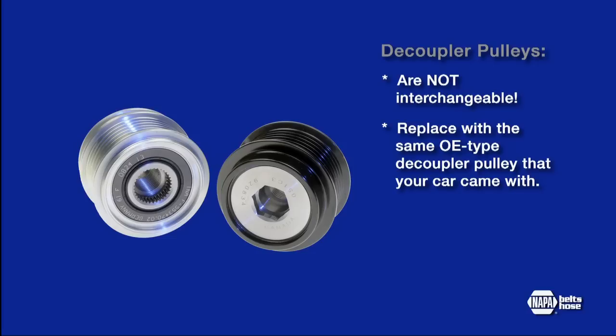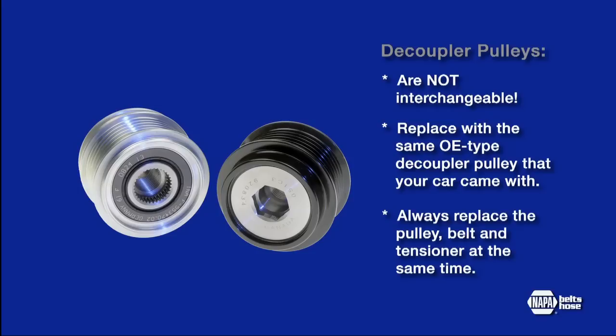The estimated life of a decoupler pulley is about the same as the belt and the tensioner. So always replace the pulley, belt, and tensioner at the same time. You don't want the frustration and unnecessary expense of having to replace yet another failed component a short time later.